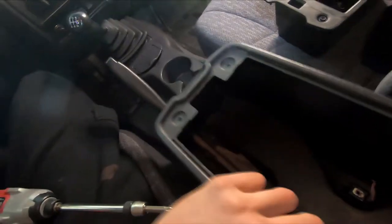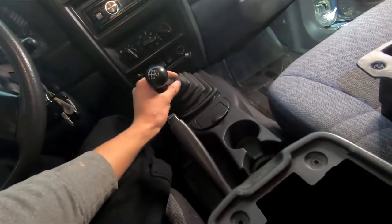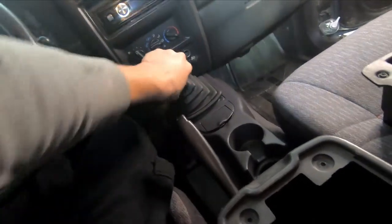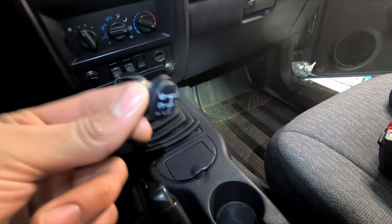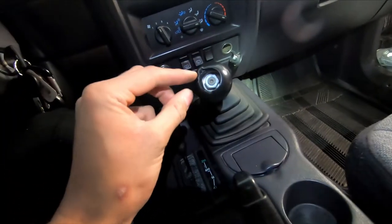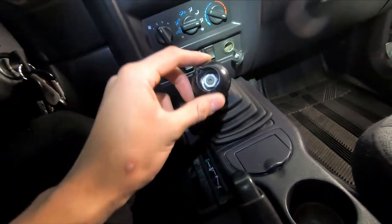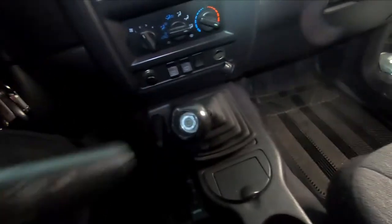I went ahead and removed the two screws — this part looks like it's ready to pop off. I had to find a way to remove the shift knob so the arm can slide out of the boot. You actually have to remove the little diagram button here — you can use a screwdriver to pry it out. I did damage the surface a bit, but it's not a problem. There's a 15mm nut here to remove and then the knob should come right off.